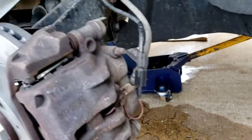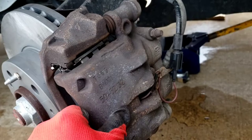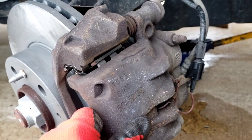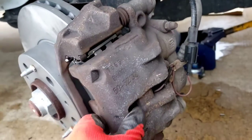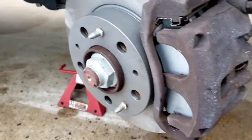Don't forget — check to make sure these things are all nice and lubed, and your caliper should slide just like that, with ease. If they're binding, make sure that you take those pins out, lubricate them, and put them back on. That's why it's called sliding calipers. Ciao.